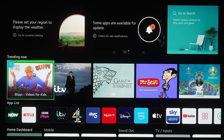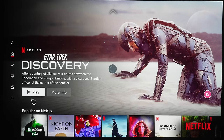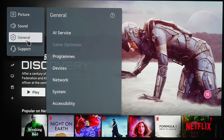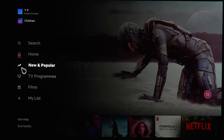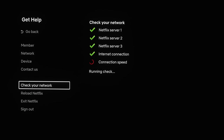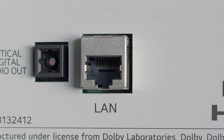On the LG C1, we're going to use the Netflix app to check the internet connection speed. I have hooked up this LG C1 to my business broadband router through the internet port on the TV itself. Going into the General submenu, then Network, you can see there is a wired internet connection. Going into Get Help and clicking Check Your Network runs a connection speed test to Netflix servers, and you can see the connection speed is 93.54 megabits per second — under 100 Mbps because of the limitation of the LAN port on the TV, which is only a 100 Mbps port, not a gigabit port.